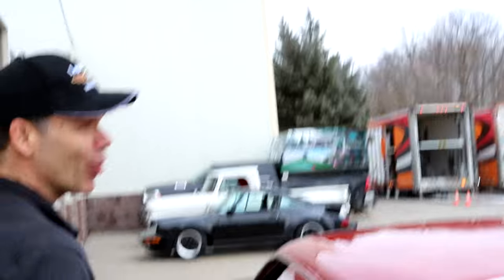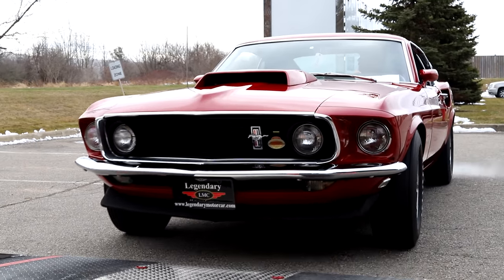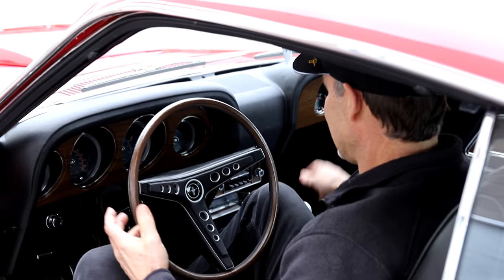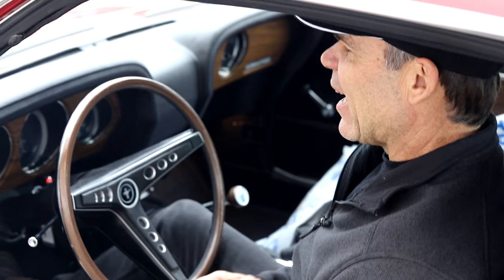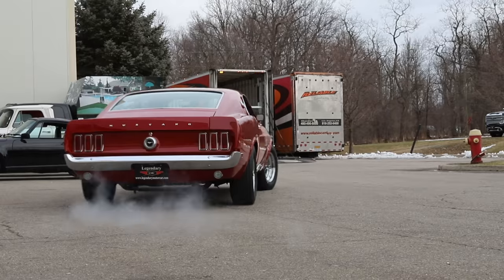Now here's the other trick. Any cold muscle car, doesn't matter what it is, they're not fuel injected. So a lot of guys flood these cars, especially cars with multiple carburetion. So here's the trick: pump the gas one, two, three times. Wait ten seconds for the gas to atomize in the intake. As soon as it fires, get it off idle, get it around 1500-1800 RPM, and let it get warm there. Once the car is warm, then you're good to go. It'll make all the difference in the world.